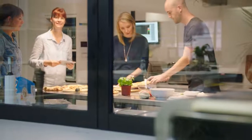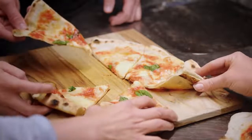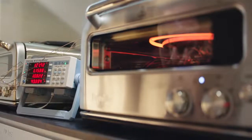As we worked through our different prototypes and testing, making so many pizzas every day, we experimented with where to put the heat and where to direct it. We've employed 3 Incoloy heaters in our product. So rather than just having that go anywhere it wants to inside the cavity, we use heat shields or deflectors, and that's actually focusing that energy on specific areas of a pizza.